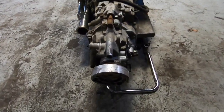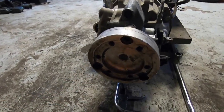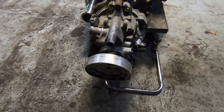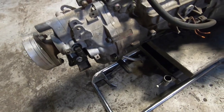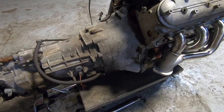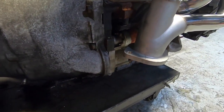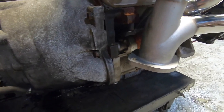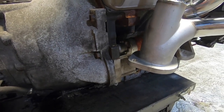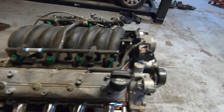This is the shifter location — I have the shifter over there and I'll bring it over. This part here comes with the driveshaft; it's a CV-style driveshaft extension. We're using the factory transmission mount right here. I'm also debating going to the 2010 Camaro SS starter — haven't quite decided yet, still working on it based on how my headers fit.